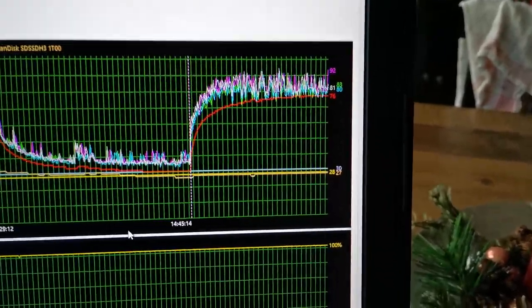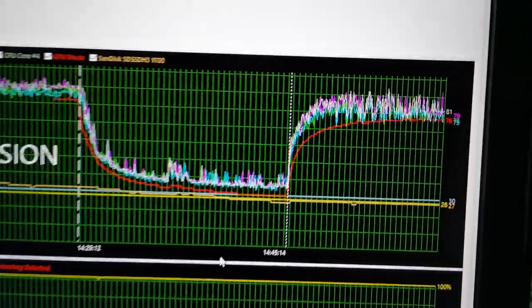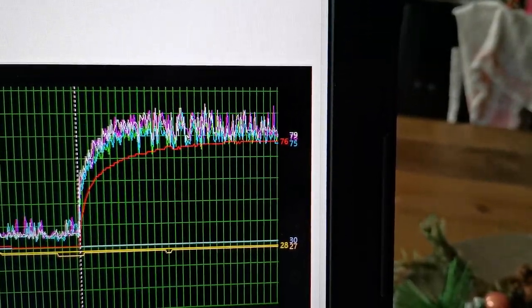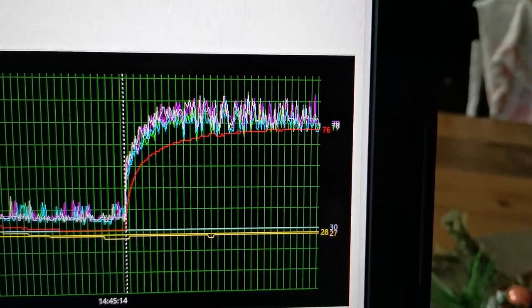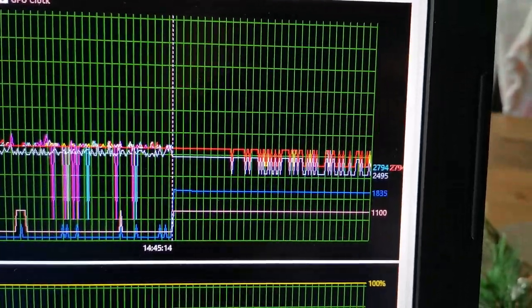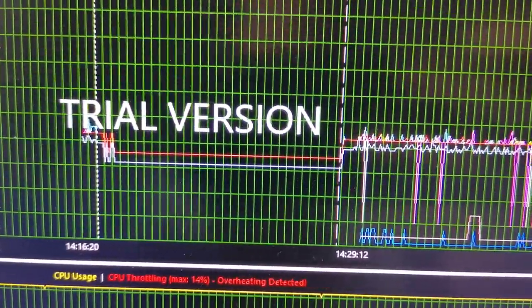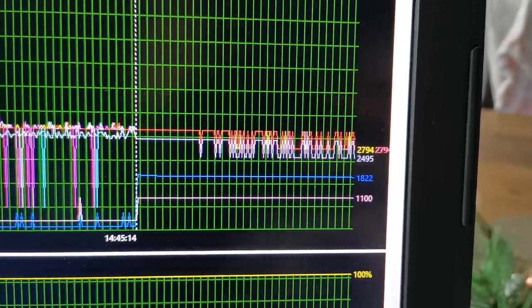The next test was done with CPU undervolting. The temperature curve is less aggressive — it takes longer for the CPU and GPU to get warm and they don't get as hot. The GPU sits around 76 degrees and the CPU around 75 to 82 degrees Celsius, which is quite a bit cooler. Looking at the clocks, throttling still occurs but it took longer to kick in. Previously it throttled immediately and stayed down; with undervolting the CPU manages to get back to its boost clock at least for a few seconds.